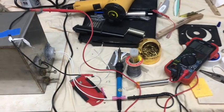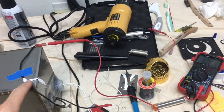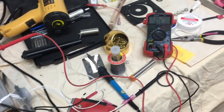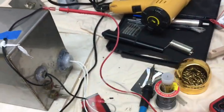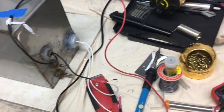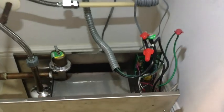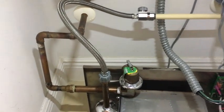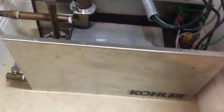Testing the circuitry: I have the float switch in series with the thermal switch. I tap the float switch and get 0.2 ohms — that's good. It wasn't working before when I had the entire wire length — one of the wires must be busted. Luckily the busted wire is not from the switch itself, so I don't have to replace the switch. Putting it back together for another test without the foam. The electrical is all good — now moment of truth.